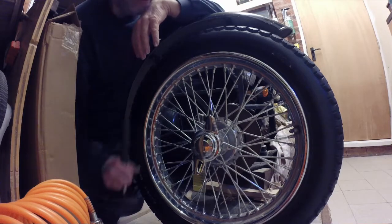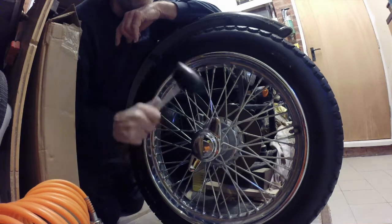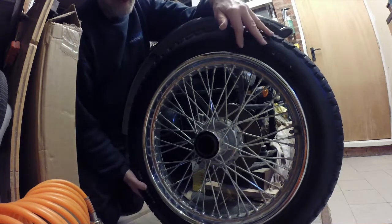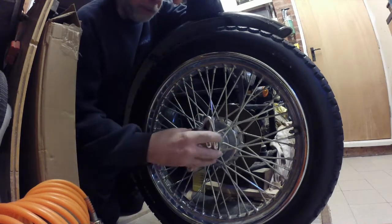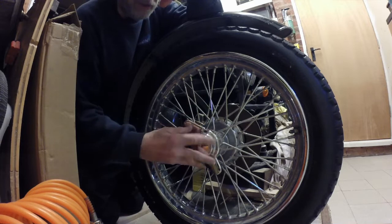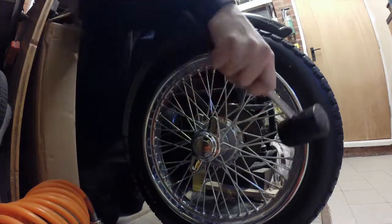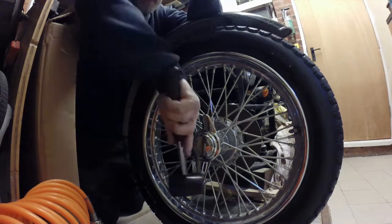So this is how Hetty's wheels work differently to most other cars. You don't have wheel nuts — you essentially have that nose unscrew and then you can lift the wheel off. It goes onto a tapered spline. Although you can use a copper hammer, a rubber hammer, or a hide mallet, it's just giving the chrome-plated spinners a bit of a bash all the while, and that's something I want to try and avoid. I want to do something that will stop me from putting all the smashing into one side, something that will spread the load.